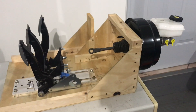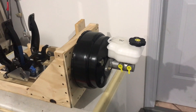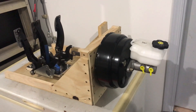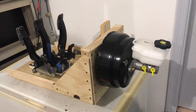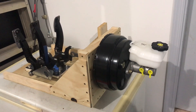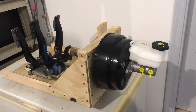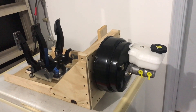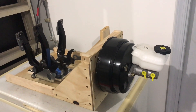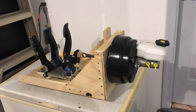You're looking at a vacuum brake assist and master cylinder — parts that come off a fifth-generation Camaro. They map to the Camaro SS fifth-gen calipers that are standard on the super light coupe. A Camaro weighs about 3,600 to 3,700 pounds, and a super light will be anywhere between 2,500 and 3,000 pounds, so you'll have plenty of braking power even for the heaviest super light cars.